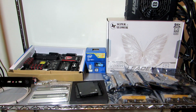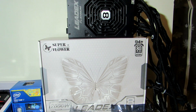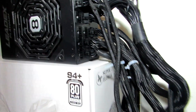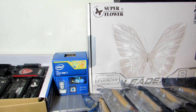This is what I'm going to be using to put together the 7-GPU mining rig. I have 7 USB PCIe risers and a 2000W power supply which I already had. I would have preferred to probably have 2 separate PSUs, but this one has 9 8-pin power connectors, so I can hook up all the GPUs with this and test it out. I might switch it in the near future.